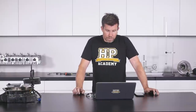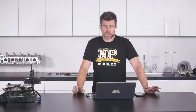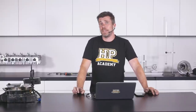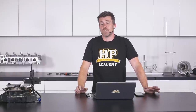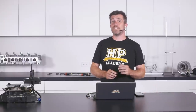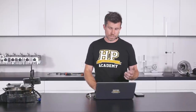Alan asks: can you use a wet sump on an everyday driven built motor? Absolutely. Through my old workshop we built hundreds of engines and less than 1% were fitted with a dry sump system. In almost every road-driven application a wet sump is perfectly adequate. A dry sump is really only warranted for engines with known catastrophic oiling problems or engines dedicated to circuit use.